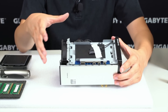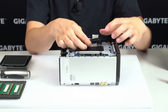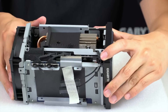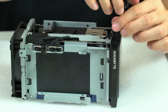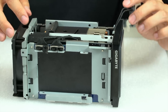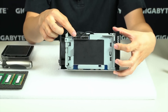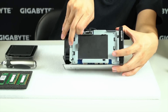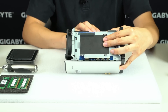Before or after removing the screws, move the SATA cables out of the way. They're taped down, so untape them — there's a little bracket holding the cable in place, so loop it around that bracket and out of the metal casing so it doesn't get crimped. At the same time there are 2 connectors with a black ribbon that you can remove by tugging — these are for the graphics card, so move those out of the way.